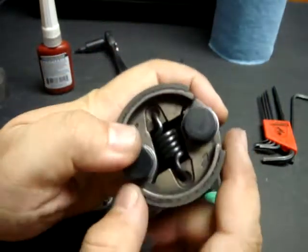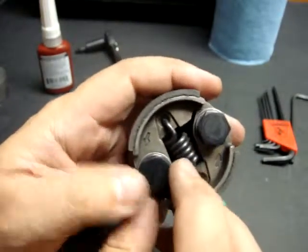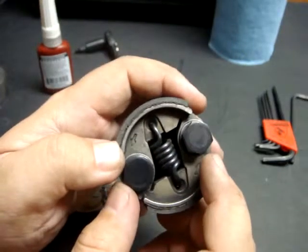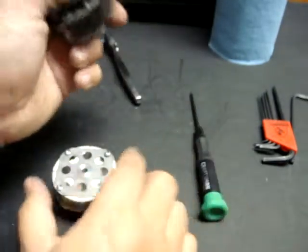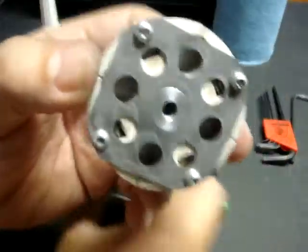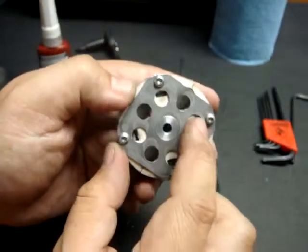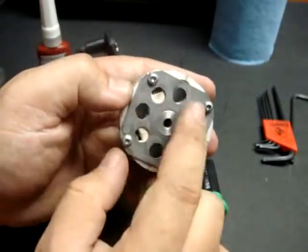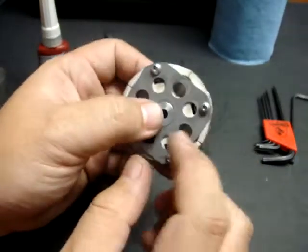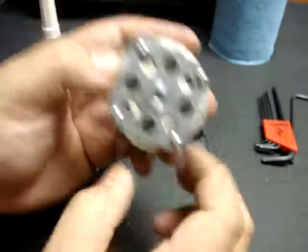This over here — I keep pulling it out — it's a really strong spring right there. That's rated for probably about, I'm not sure what the black spring is, maybe 6,500 RPM. This is not only superior in its gripping ability, it's also superior because it's adjustable. There are four springs in here on each side of the shoes, and that allows you to adjust the RPM engagement.